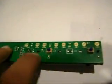So we look at the first box right here. We've got 2 solder points. The first point will be the positive one, and this is where we're going to start from, where we're going to hook everything in series, and we're going to assume that there are no lights here at all. We're going to start from the first pin, hook up the first positive pin of the LED into this one, and from this point forward, we're not going to solder anything on the board. We're going to solder the LEDs together, positive to negative, negative to positive, and so on, but we're not going to solder anything on the board.